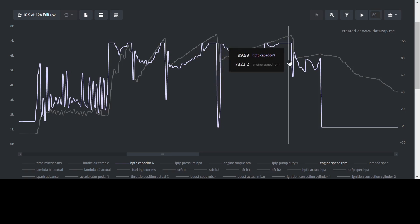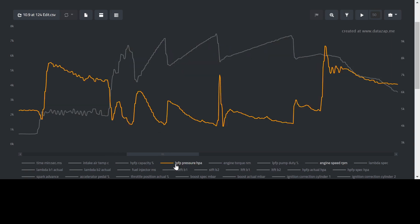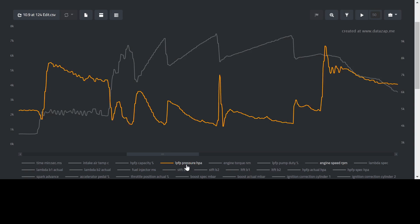This is definitely not safe and not the way it is meant to be running. So one day I thought to myself, I don't think I've actually looked at the pressure developed by my low pressure fuel pump. The lowest you should see is 4,500. At the top of first I'm seeing 4,100. At the top of second, 4,100. At the top of third, 4,100, and at the top of fourth, 4,200. Clearly not performing the way I need it to in order to provide fuel pressure to my high pressure fuel pump to do its job properly.